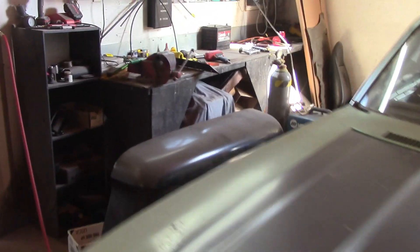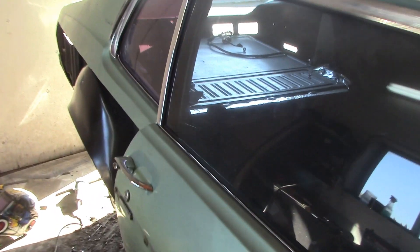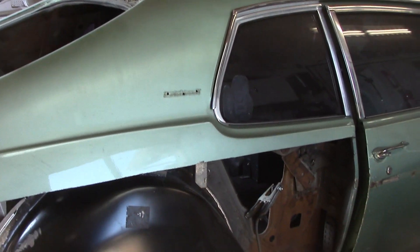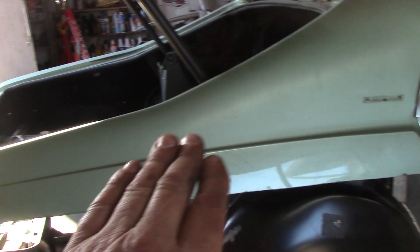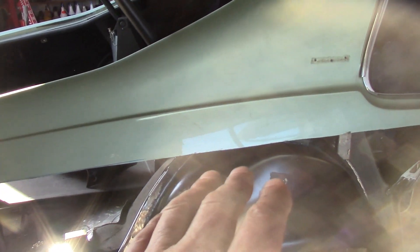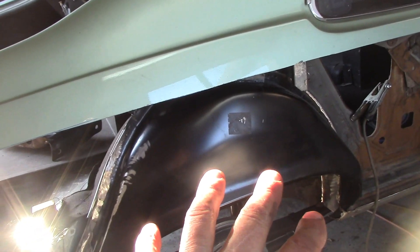On the back here, apparently they couldn't find quarter panels for a hatchback. The panels they got are for a two-door, but a two-door is different than a hatchback — the quarter panel's main part is the same, it's just different up along the body line. So I've cut it where I wanted to. I had to cut it up this high anyway — it was quite rusted out down below. Had to get in there and replace the wheel tub.